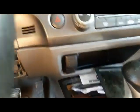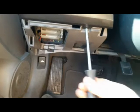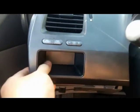After the plate is out and I've taken out the two screws, I go back to this panel I just pulled out. There's a Phillips screw right here — I just take it out. This is a black screw, where the other radio area has a white screw. Now what I'm going to do is pull this out — it's all held in by clip — so make sure that screw is out of there.